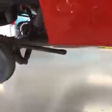Now the rear of this, right now the axle sits on the bottom of the spring, and with this kit it's going to allow us to flip that rear end on top of the spring, which will give us our drop that way.